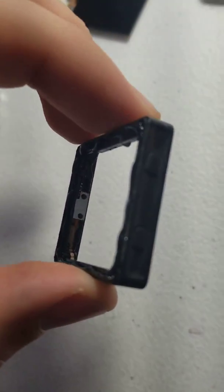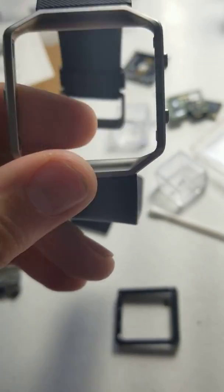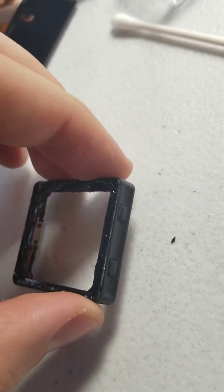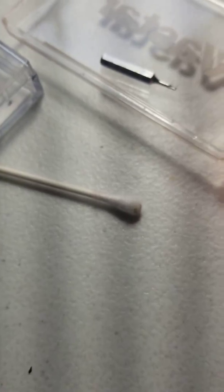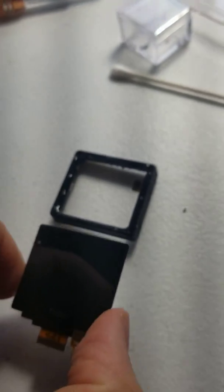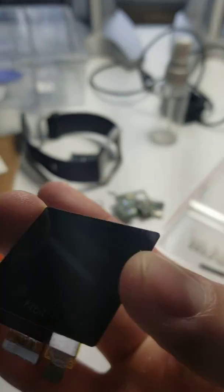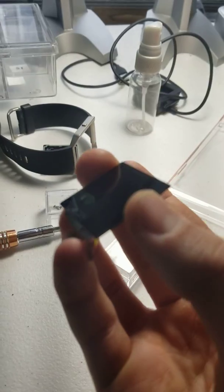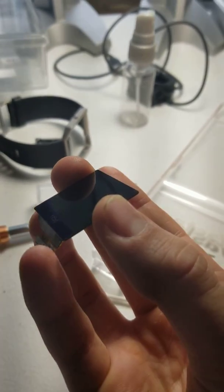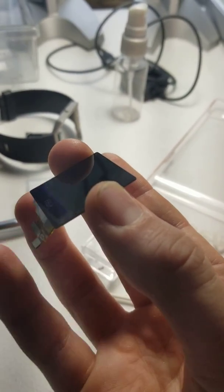You want to make sure the two buttons are on the right because it sits on the watch face like this on your wrist, so the two buttons are on the right. When you have the two buttons on the right, make sure your hands are clean when you're touching the LCD. Then this would go with the logo at the bottom and the two buttons. One thing you want to do is on the new screen, fold these down just a little bit — don't bend them too much, but flex them down just a little bit so that you don't get them in the adhesive.